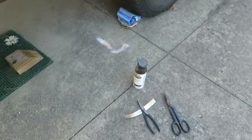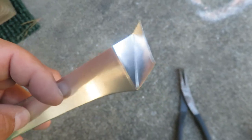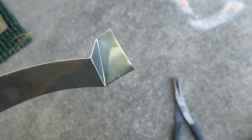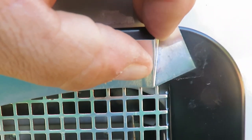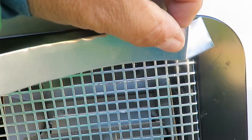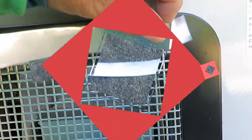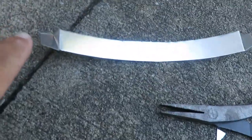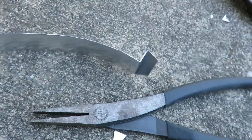I put a little bend in — I'm not sure exactly what the angle is on the end, but I left plenty of material. This is going to meet up here and give me my angle. I'll end up trimming this piece and putting the rivet in here. I'll do that on both sides, leaving a little extra room just in case I'm off a bit. I've got a nice bend on here, and you'll see how that works at a slight angle on each side.